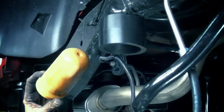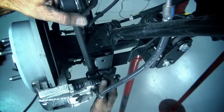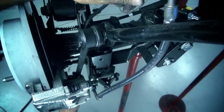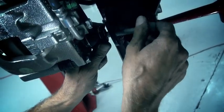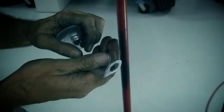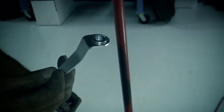Twist and push the bump stop into position. The sway bar links install with the looped end at the bottom and the ball joint end at the top, with the stud and nut to the inside. The lower end mounts on the outside of the bracket as well. Reinstall the spring isolator and new rear coil springs. Use the provided wrench — it really helps with the install of the spring retainer.